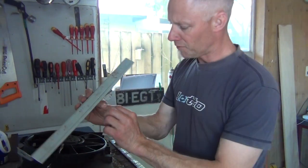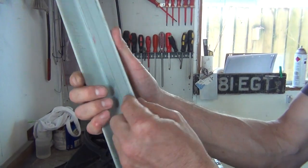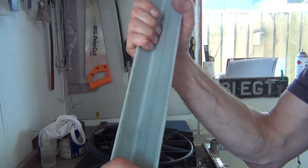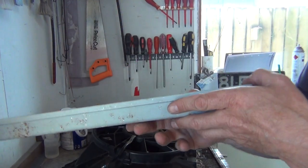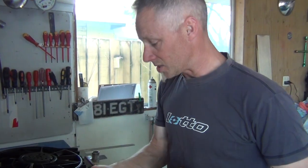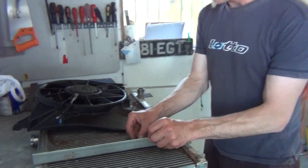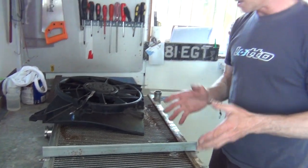So the secret is folding what we call safe edges — folding the panel steel right back on itself makes it super strong and rigid. Of course, the right angle itself, instead of being floppy and flat, becomes rigid like right-angled steel. That's the lesson: use right angles, use safe edges. Use panel steel to fabricate brackets or mounting plates.